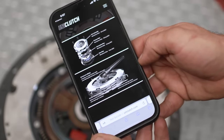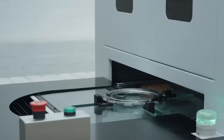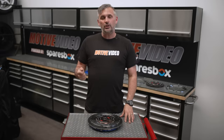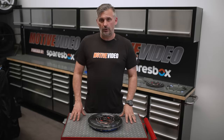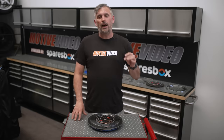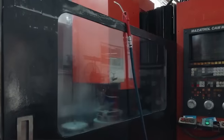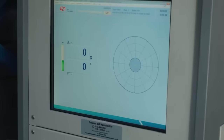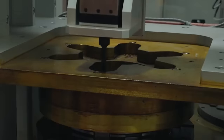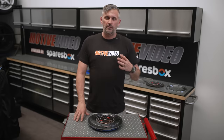That's right — not just the specs that it should have, but the physical test results. When this gets assembled and goes through its autonomous quality control checks, it gets tested and they actually check how much torque it can physically hold, rather than just giving you the theoretical amount. It also gives you all of the measurements done as part of that testing. What I love about this clutch is that it is CNC made in Melbourne, Australia. They balance the rotating assembly, physically test it, and store all of those test results for you to see — which is great peace of mind for the end user.